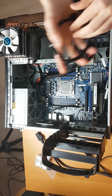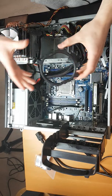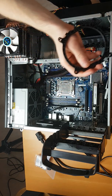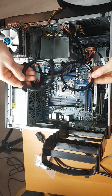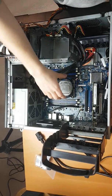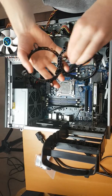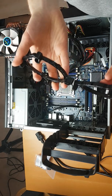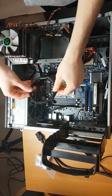This part of the video we're only going to be doing the hardware itself, and then maybe later I'll do one showing the performance of the E5-2690 V1. This is the adapter for LGA 2011 — it is different. I can quickly grab the original adapter which came with the cooler. This one won't fit on the board properly just because of how large the socket is. The LGA 2011 adapter is only meant for 2011; the other one can go on LGA 1155, 1150, and all the other CPU sockets.